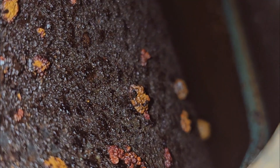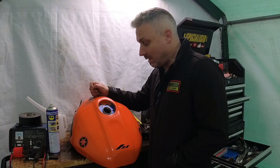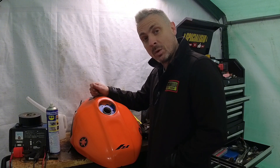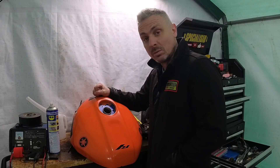So we've taken the tank from this to this. That's how to do the electrolysis on your fuel tank — it took about two weeks to be honest, but probably could have done it quicker. You don't have to use the distilled water, that was just a choice to get a better result.